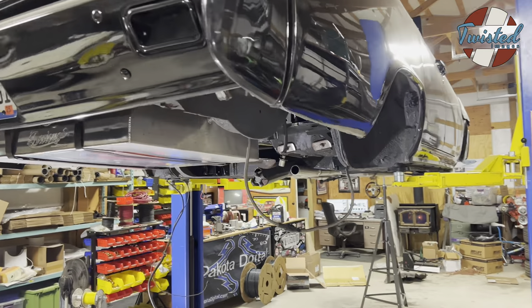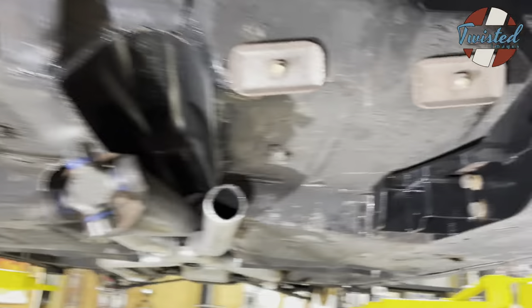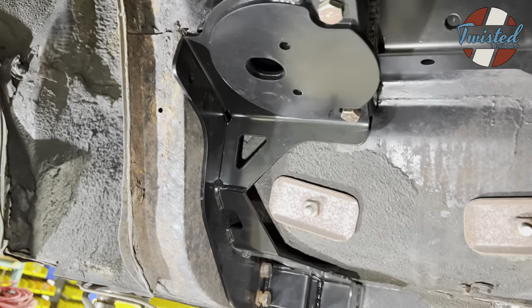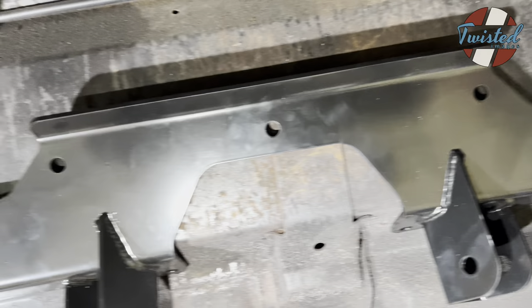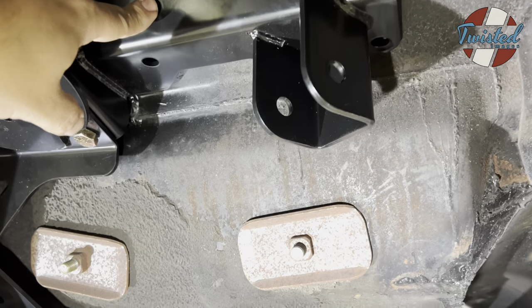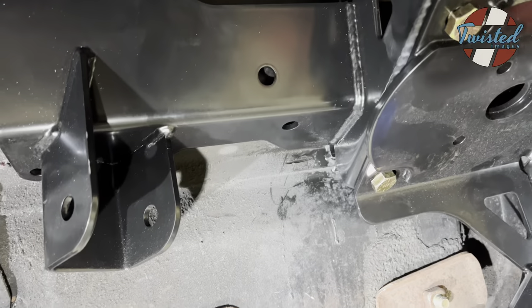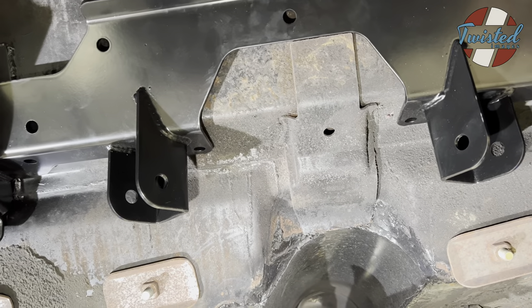Notches are bolted in and we've temporarily bolted in the side plates and the bridge plate. What we're going to do is mark all of the holes in this plate that need to be drilled into the sheet metal of the underfloor structure for nutserts — nine nutserts total going in here. We'll mark all those, get the nutserts in, and then we can bolt all this up for the last time.